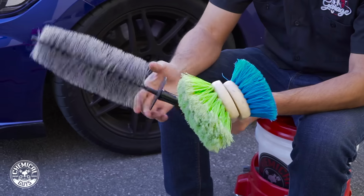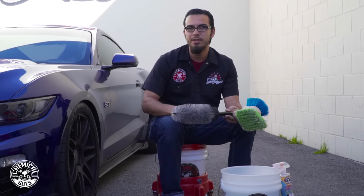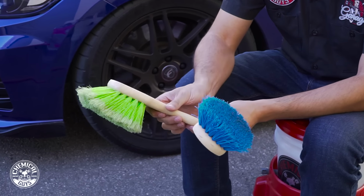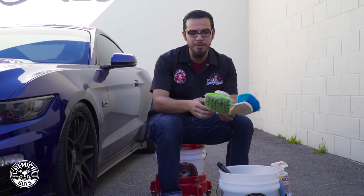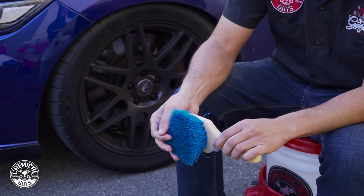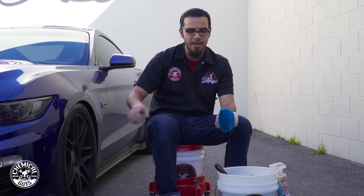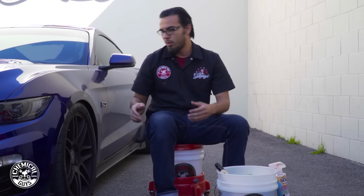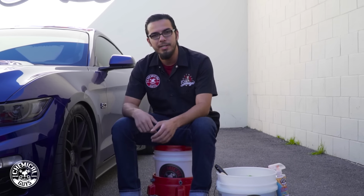This is a soft bristle brush that can contour to the spokes or anything that's intricate around the wheel. This way we can get off as much of that brake dust and get this wheel looking right. Then, we're gonna clean the face of the wheel using our green flag tip brush. This is a soft bristle brush that cleans off the majority of the face, which is the most obvious area. And then to finish it off, we're gonna clean the tire using our Stiffy Blue Brush. This hard nylon plastic brush takes care of any road grime or previous dressings to bring back that natural rubber, and it'll make it easier for us to apply new dressings so it'll last longer and look better. But before we begin, we're gonna rinse off the wheel to get as much of the heavier loose brake dust off, and it's gonna make it easier for us to clean.